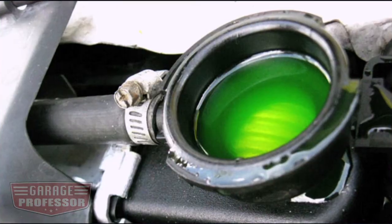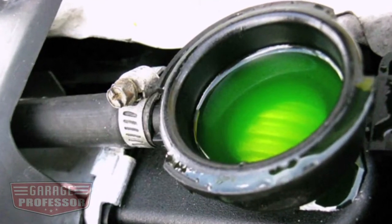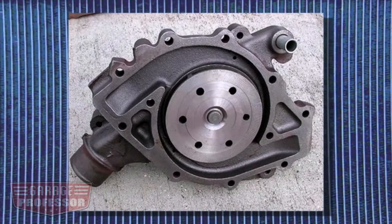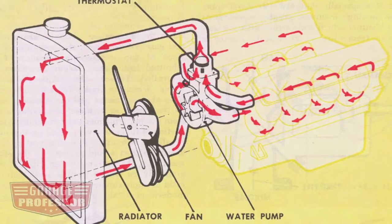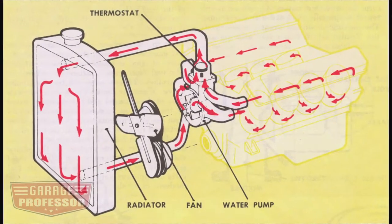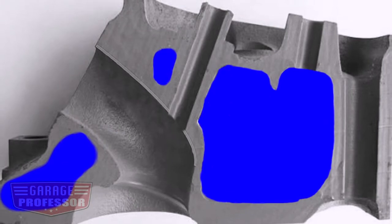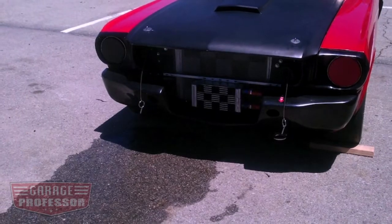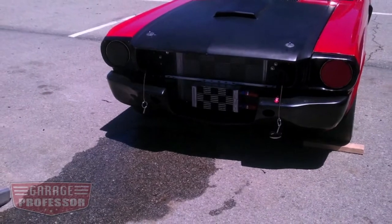temperatures. What a cooling system additive does is reduce the surface tension of water, which makes it flow more completely over the surfaces. This allows more water to metal contact. Hot spots are reduced and heat transfer is increased. The entire system becomes more efficient. I use this in my race car as this was a frequent sight in the summer heat.